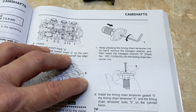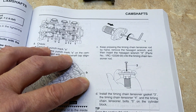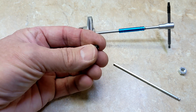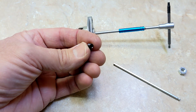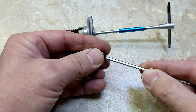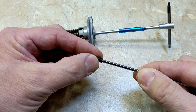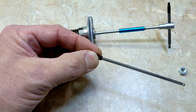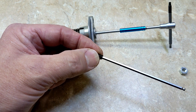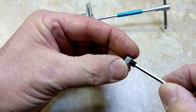I went online and I couldn't find one of those. I did see that it comes with a new cam chain tensioner. So I went down to the hardware store and bought a set screw, and I'm going to take my allen key and pretty much slide it in like that. It slides in about an eighth of an inch. That'll allow me to turn the allen key, and I bought a six millimeter threaded nut and I'm going to spin it on like that.